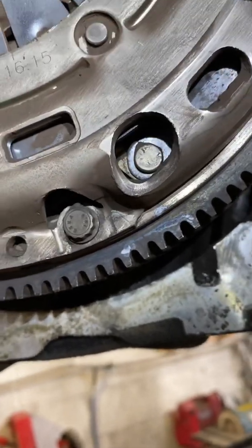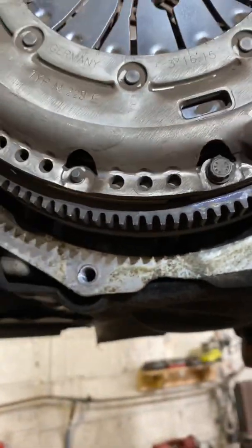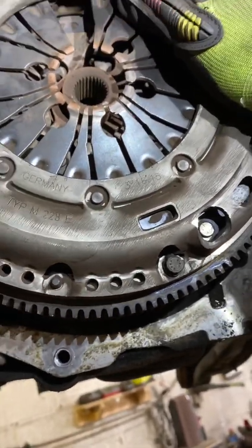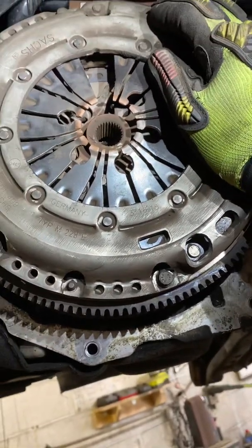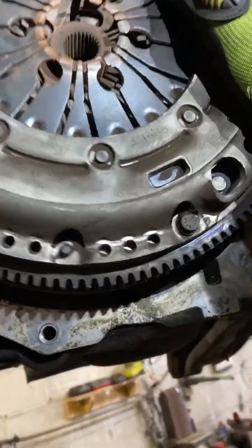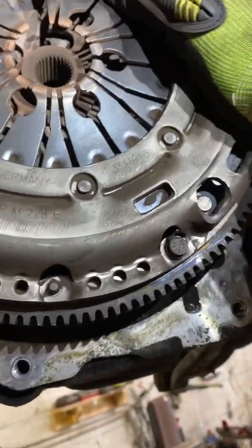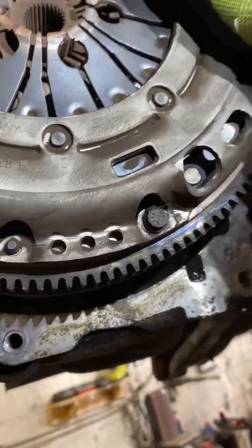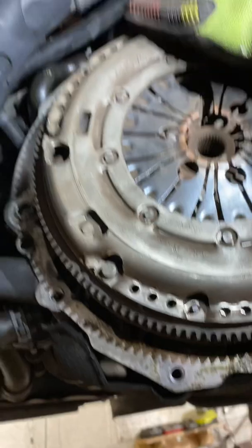They say you're not supposed to have more than 13mm of distance, but what I do is not concentrate so much on whether there's 13mm of movement — it's about how the movement feels. This is just clonk one end, clonk the next; there feels very, very little progression in that, so that's a good start.